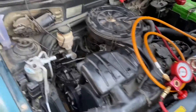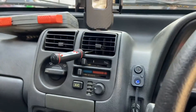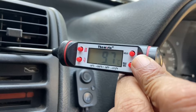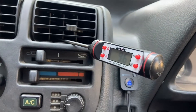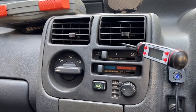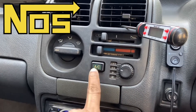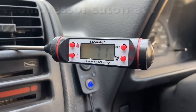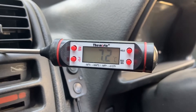This bottle has very little quantity of refrigerant left inside. Now let's go and check the cabin for the cooling effect. Oh man, chilling air in the Zen after ages! There you go — 9.9 degrees centigrade. To be very honest I don't recall the last time we had used AC in the Zen. This is chilling properly! In this generation of cars the Zen owners would appreciate — the AC button was similar to the nitrous switch. For quick overtaking manoeuvres we used to turn off the AC to release the load from the compressor and the car used to get a proper boost. The compressor has cut off at 7.1 degrees centigrade — that's a really good benchmark, as good as the AC in modern cars.